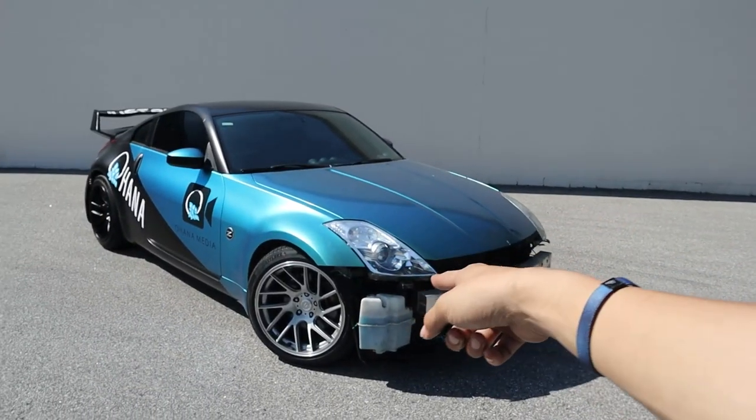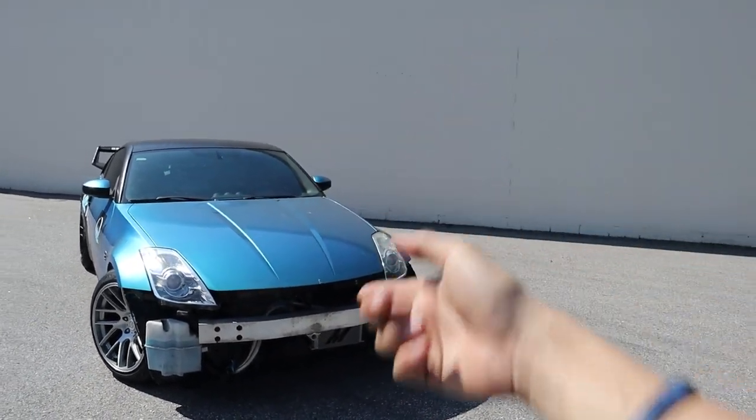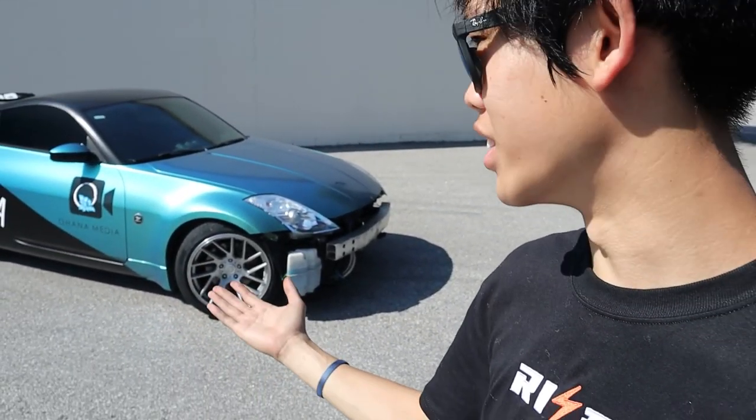I did end up running out of time to wash the car — I'll wash it tomorrow before I bring it back to the garage. But the 350Z, we are going to say, is drift ready. We ran into so many things out of nowhere but we pulled through. Thanks to Sunny and my dad, we were able to change out the wheel hub and bearing, the control arms, install the oil cooler, do an oil change, oil filter, and even change out the shift knob setup as a little cherry on top. That is a wrap on the Z. The next video you guys will see this car in a very cinematic one of us taking it to swing it along with the BRZ. Now I know a lot of you are going to say the car is basically stock — how is that drift ready? We wanted the car to be at an OEM state. We mainly did maintenance so we could swing it first in OEM form and get the idea of how the car swings before we add more upgrades.